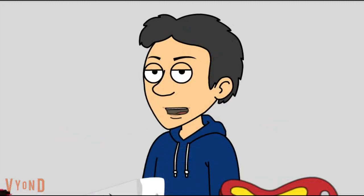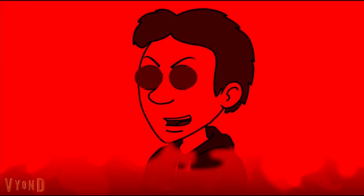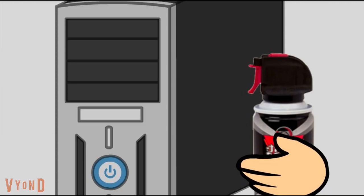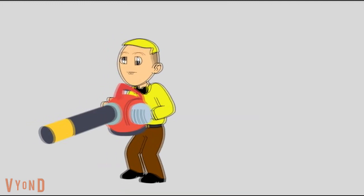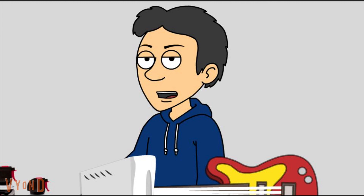Carefully remove the housing — it's alive! Welcome to the interior. This isn't so scary — we're not even going to touch anything. Grab your dust-off gaming duster and, blowing from the inside out — very important, inside out — spray the fan. Then spray the motherboard and other components. Do not use a leaf blower. Do not use a vacuum! Vacuums can cause static discharge and could severely damage your computer.